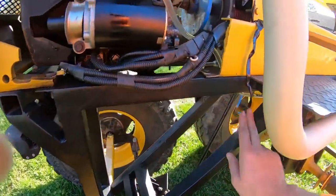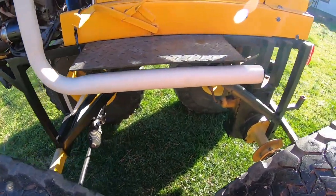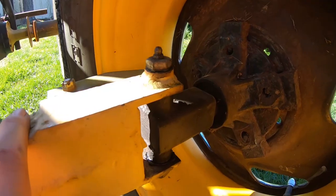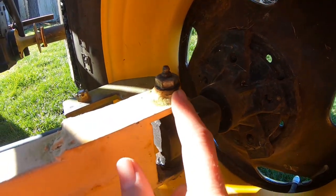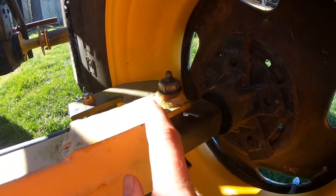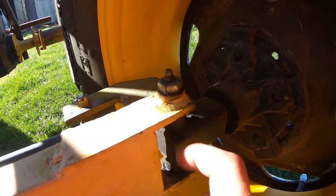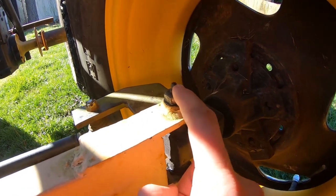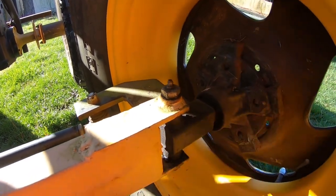We built the entire subframe out of scrap metal we got from a junkyard. The front axle is made completely from scratch. After about 4 years, we wore out the kingpins. So we ended up making new ones, welding on some 1-inch cold roll right here to add a little bit of extra strength, changed our bolts and put a greaser in the front so we can grease everything, trying to